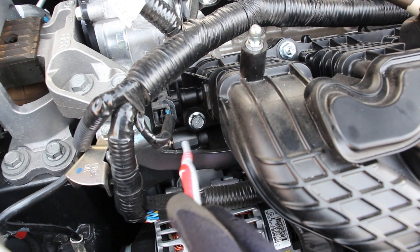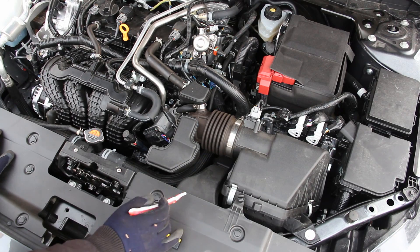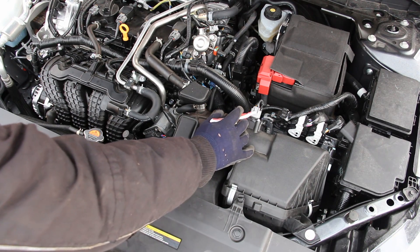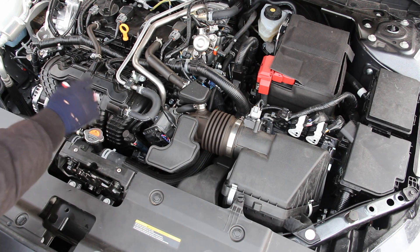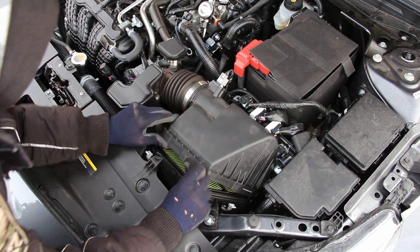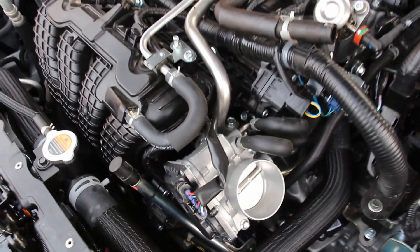Here on the other side of the intake is a fuel rail pressure sensor. Now looking at the air intake system on the Altima, we have air that begins its journey at the front here and is then sent straight down into an air resonator below. It'll then come up through this air box, get filtered out, pass through the mass airflow sensor, and then into a drive-by-wire throttle body before going into this plastic intake plenum and then sent down into the engine. Changing the air filter on the Altima is pretty easy — just two clips and we pull off the air box. With the air intake removed we have clear access to the drive-by-wire throttle body and the plastic intake plenum.